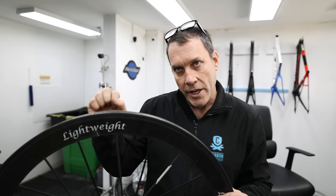There are upsides and downsides to carbon spokes, but I haven't seen them as being that necessary. Whereas if you look at an alloy spoke, it will buckle before it breaks — a carbon spoke will not. I've actually got a set of carbon-spoke Parcours that we were supposed to be testing, but I'm scared now.